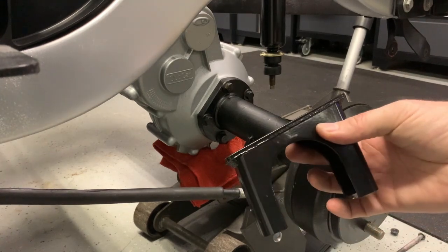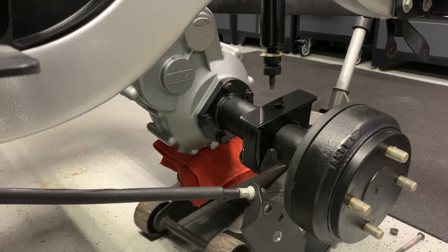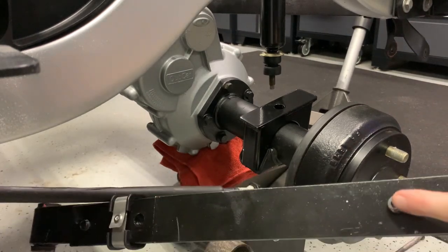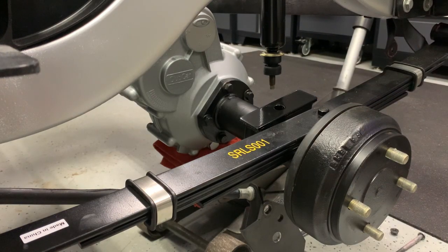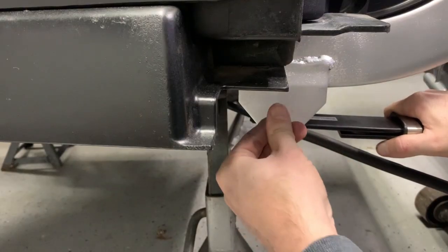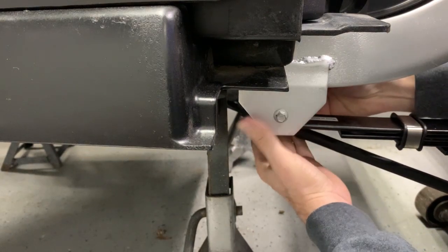So the kit has these lift blocks. The orientation they want you to have is the sloping side going toward the front, so that just sets in like that. Then we're going to put the leaf spring in between — the leaf spring can now go back in, it has these pins on it. This pin will sit here, so we'll have to make sure we got this dropped enough. I'm going to have to drop the axle a little bit more to fit it in there. Pin in there, axle's back in the bushings. I'm going to put the brake cable hanger behind here, over that bolt.